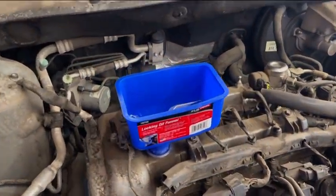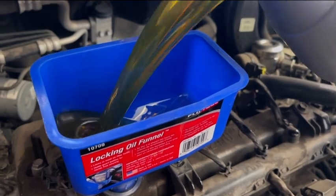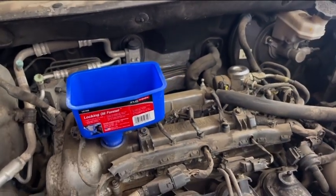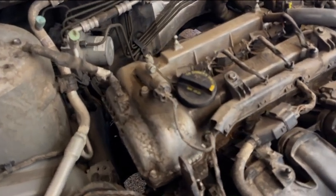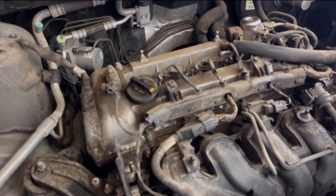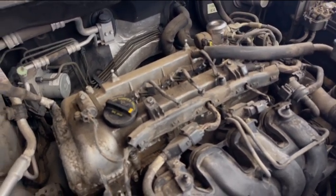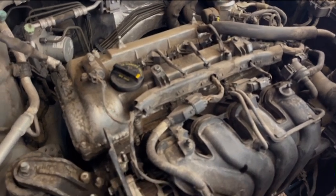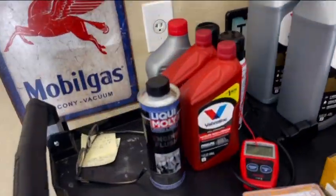For round two, with the three quarts of ATF, we're also going to put in about half a quart of the 20-weight-50 racing oil, because it's much thicker than your standard oil and will support that really thin ATF as it flows through the system. It's 1:03 PM — 3.5 quarts of ATF going in, topped off with half a quart of 20-weight-50 just in case. We're going to let this run for a full hour, then drain it and do another flush with ATF.